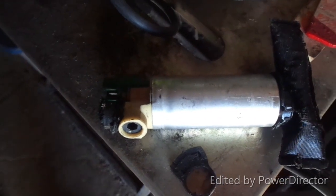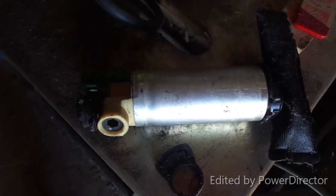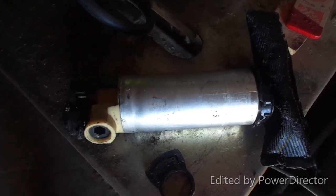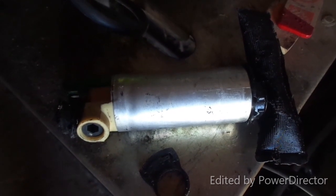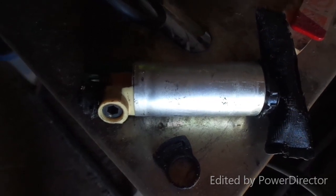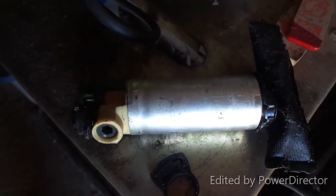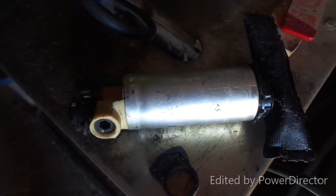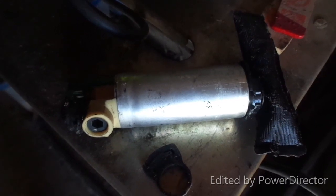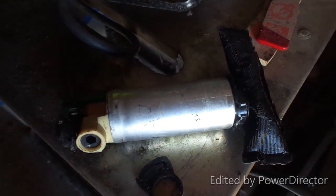I'll run a little piece of copper down and tighten it up as well. I went with a new sending unit because it was a real hassle getting the old one out — probably because I did double work trying to pull the tank, then put it back, then take the bed partially off. Since that sending unit is who knows how old, I just went ahead and ordered a new one so hopefully the gas gauge works when I get the truck back together. Anyway, that's what I found — wondering if maybe that deteriorated hose was part of, or all of, the fuel delivery issue why that truck didn't start and run. Thanks for watching, see you in the next video.